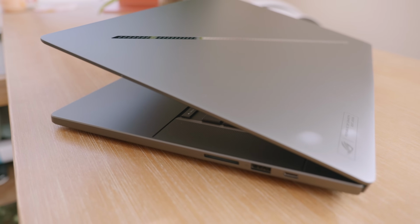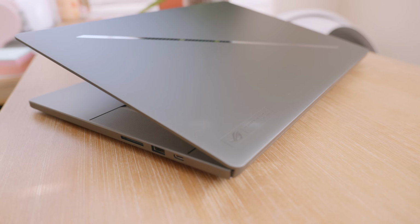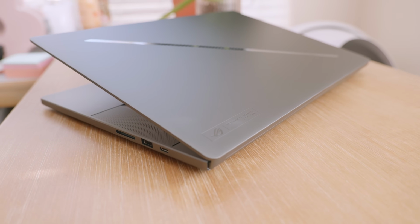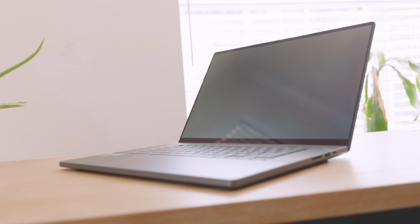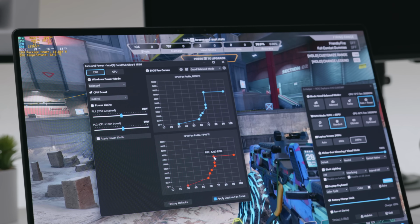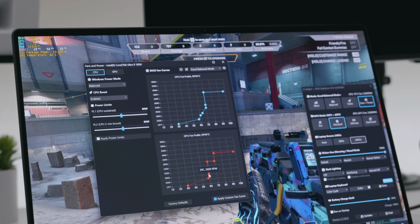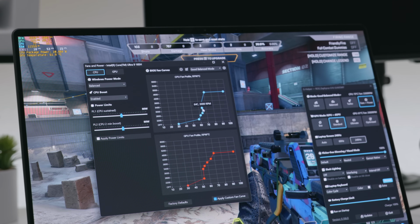Another cool thing about the fan noise I just wanted to add here real quick is that the developer of G-Helper added a new experimental fan curve that is much more exact, and you can even go beyond what the BIOS would normally allow for the fans. This means that you can get very exact RPM at a very exact temperature compared to normal fan curves. The best part is this means you can literally have the fans completely shut off. So absolutely 0 RPM no matter what, of course at your own risk, but just a cool little thing I thought I'd point out.